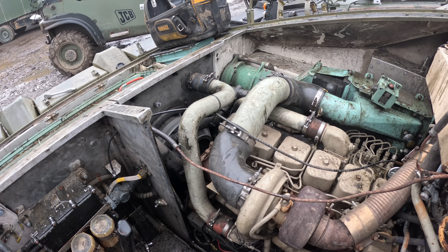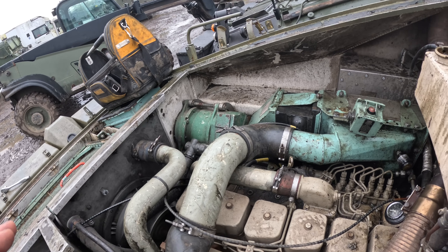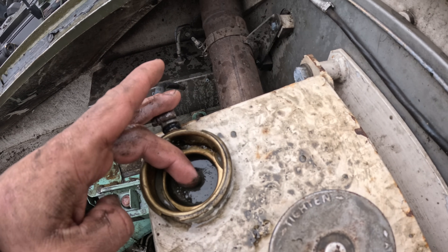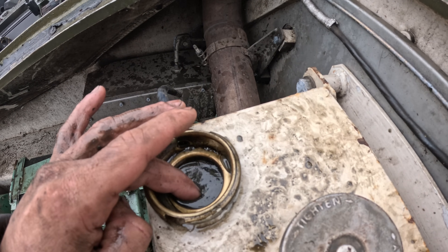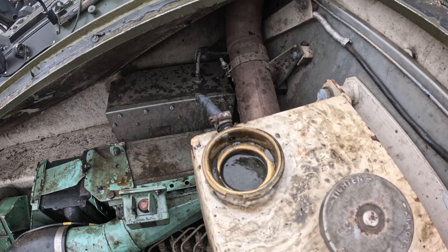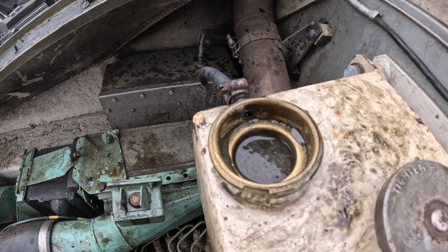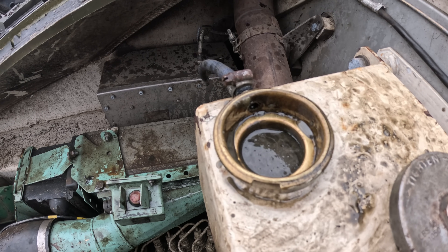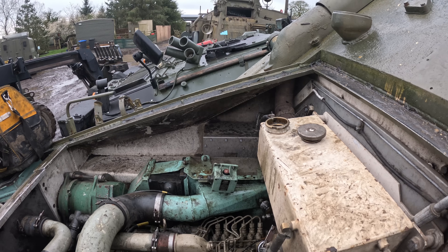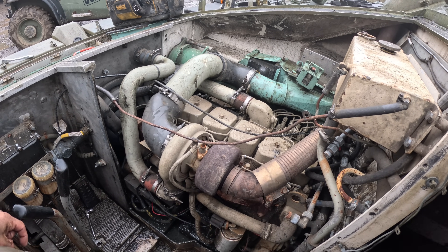It's starting up and running very well. There's definitely oil in there but I'm not seeing bubbles come out - potentially we could just be looking at a blown oil cooler. I think I'm going to take that off once it's all down. Potentially we could have it fixed with a new oil cooler.